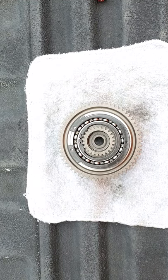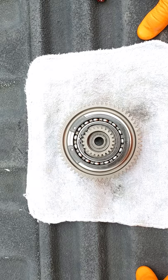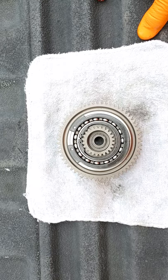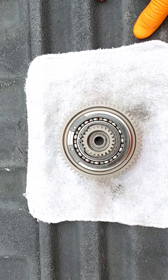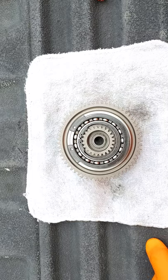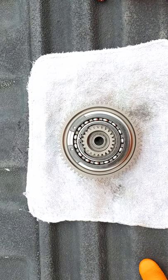Hey guys, it's Lee. I've got a Yamaha SVHO supercharger clutch pulled out of my jet ski. It's a 2017 GP1800. Back then they didn't have the HO SVHO denomination — it was SVHO only. What I've got here is the supercharger clutch. It's the new part number 6ET-17800-00. Yamaha lists it as a gear unit assembly — not a supercharger clutch, not a sprag clutch. You won't find it listed under those names. Gear unit assembly is what they're calling it.